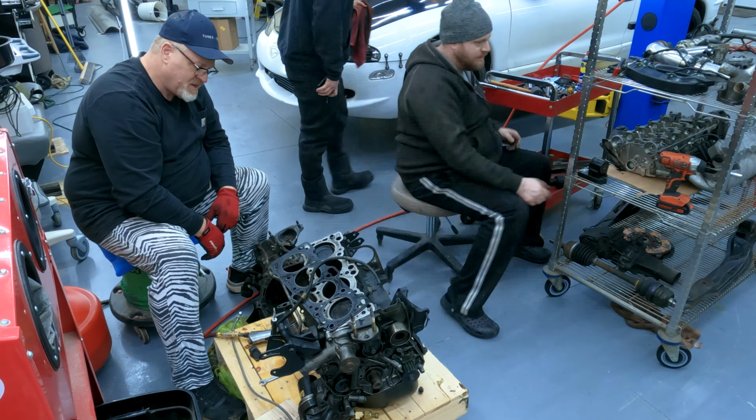So I got a lot of it, but next things I've got to do are I'm going to get the bumper off and the headlights out to get this whole front radiator support area opened up, and then so I can get this ABS module out of here, because we are not going to have ABS in this thing. That'll clean up all these brake lines. I can take off the proportioning valve, and yeah, that'll be close to everything. Got the clutch master cylinder and the brake booster. Yeah, just about emptied.